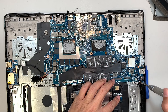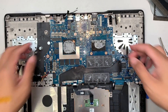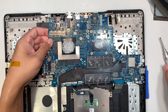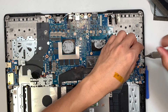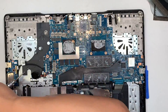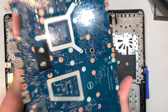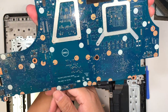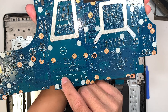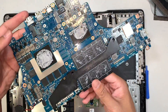There's one tiny screw here for the USB-C port — we need to remove that as well. Now the entire motherboard will just come right out. If you want to do a replacement on the motherboard, find the model number here: Vulcan 15-N18E — that's the main board model. There you go — that is your motherboard.